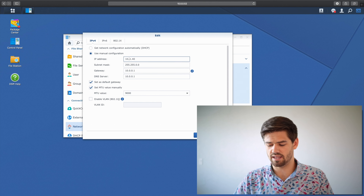You should see that LAN5 is now connected. From here, go into Edit and set the MTU to 9000 for Jumbo Frames - but everything's got to support it. I know my network card and my computer does, so I'm going to do this. If you want more information on Jumbo Frames, I've already covered this - I'll leave a link in the description.